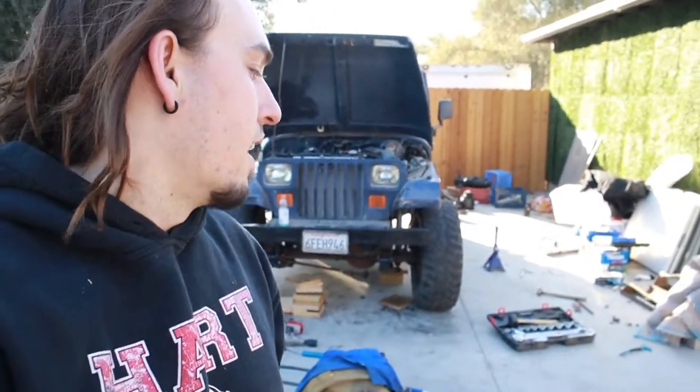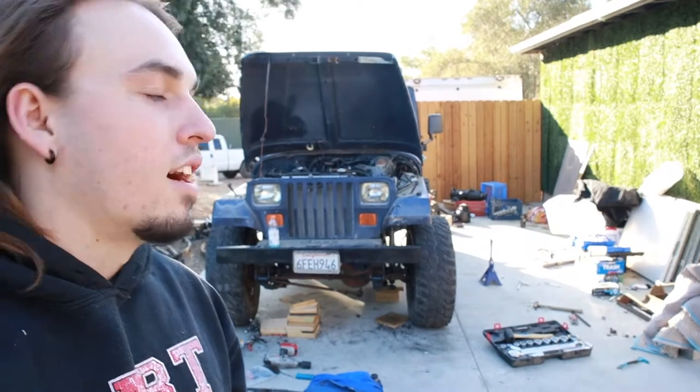Yeah. I ordered the kit off Rough Country online. And online it says, is it a manual or standard car? I didn't read it that well. It said manual or whatever. I said manual, thinking that maybe they need different spacers or whatever for the drop back for the transmission, because transmissions are different. What they're referring to is, is it manual steering or power steering? That's what they're referring to. So the pitman arm is wrong.